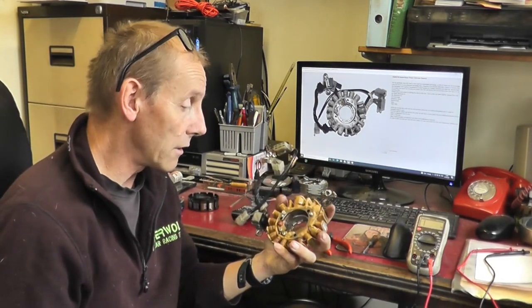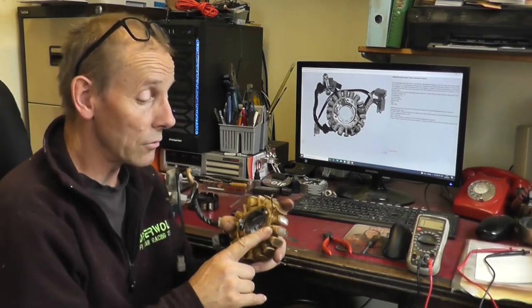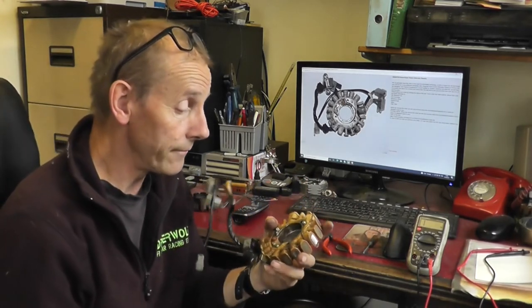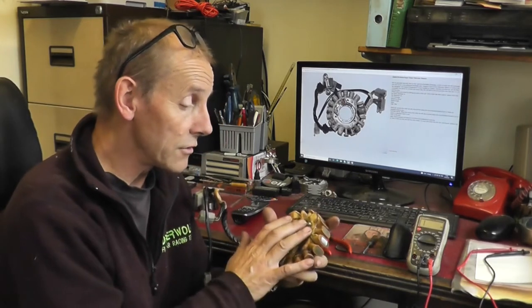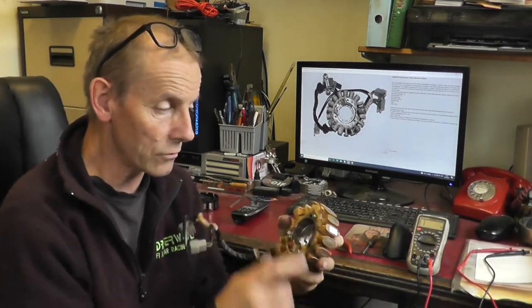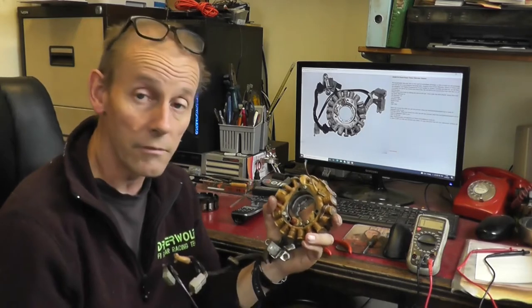I'm going to rewind this. I'm going to do all three coils because these are old now — 40-odd years old. As a rule I rewind both the two low speed source coils, and I've got no choice but to do the high speed source coil now. These have got a 0.14mm wire on the two low speed coils, but the high speed uses a 0.3mm — almost twice the thickness — and it hasn't got so many turns: about 350 turns on that one, whereas these have got thousands of turns. The good thing about these 250 alternators is these other poles aren't wound, so you can get access to it quite easily.